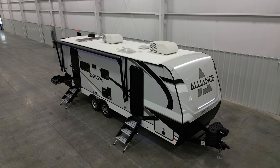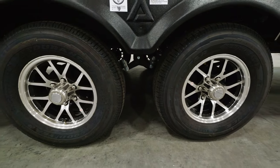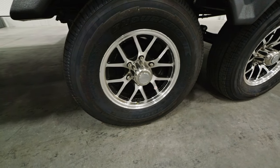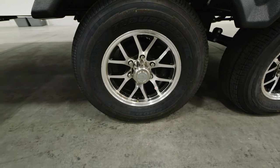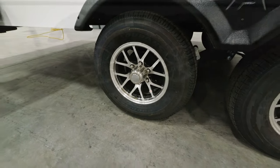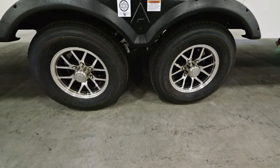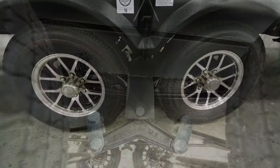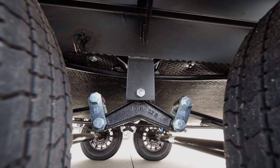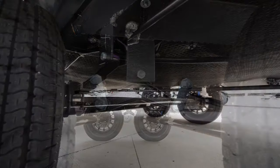Let's focus on some of the running gear enhancements. We have a number of great upgrades — a few of which are the fact that we're using standard Goodyear Endurance tires. It's not often talked about in the industry in terms of running gear, but that's the full foundation of the product. Having that peace of mind in your travels going down the road — an eight-hour drive, a half-hour drive, whatever it would be. We're certainly happy to be using these Goodyear Endurance tires, which also still have that tire pressure monitoring system prep. Our leaf spring suspensions also use welded V-bracket spring hangers, which is typically one of the very first things to fail over time — so we're doing that from day one.